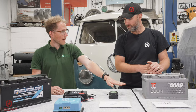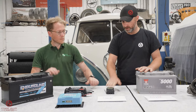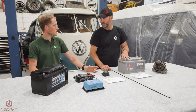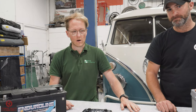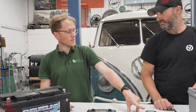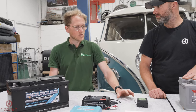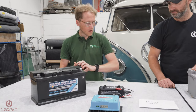When you turn the engine off, the voltage goes back down, the relay opens and the batteries are separate. It's tried and tested and cost-effective, but sadly no longer any use when you've got a smart alternator, because the voltage will frequently not be above that threshold — and it can also go much higher than you want to put straight into a standard leisure battery, so you run the risk of damaging it.